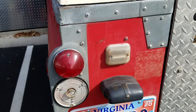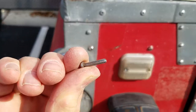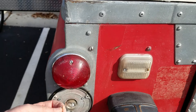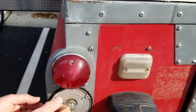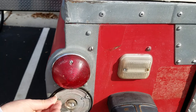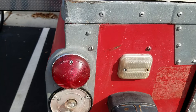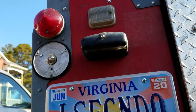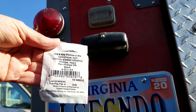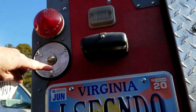So I've got to find the right size and the right head for it. I removed this screw from the other tail light and it looks like it fits pretty well. So I need to make another trip to the hardware store. I purchased these Phillips pan head screws — they're 6-32 by 3/4 inch — and these are the screws that actually fit this perfectly.